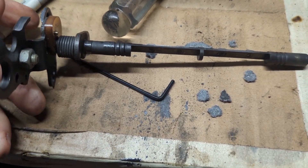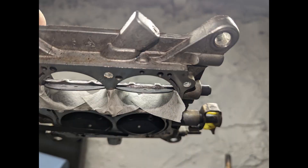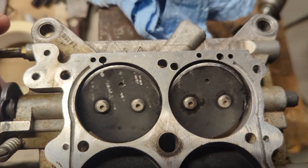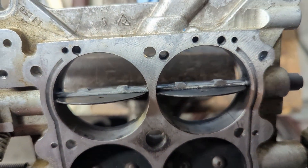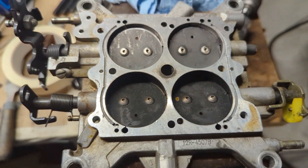The throttle shafts are already machined down, but there's more that I plan to do to them. I thinned them out mostly on the screw towers and the leading edge for airflow. When I had the blades out, I also put an edge on them with a file. After reassembly, I carefully ground down the screw heads. Be sure to use some Loctite when you put them back in.